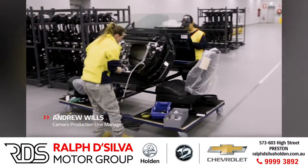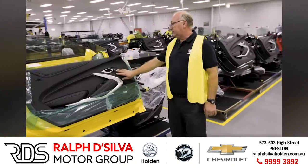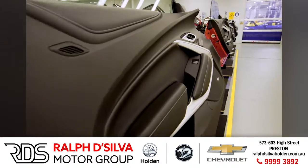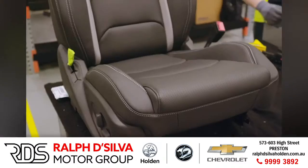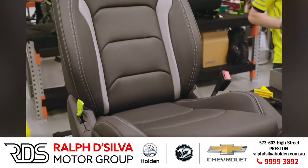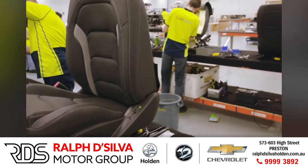This is a sub-assembly of the doors, removing the left hand harness, the right hand harness, and flipping them over. This is a standard left hand drive door trim. This is now the left hand door, which is our passenger door here in Australia. With the emblem there, the left hand seat becomes the right hand seat. They have to take the wiring out of the left hand seat and put it in the right hand seat, and vice versa.